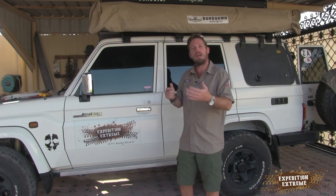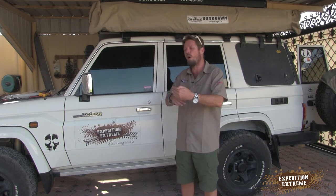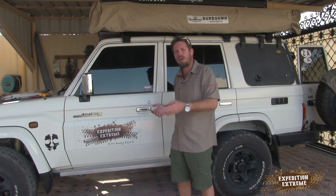However, if I'm drawing power and not replacing it sufficiently with my solar panels, I'm going to have the issue that I have right now, where after day 3, day 4, my batteries weren't sufficiently charged, so the overnight usage was bringing my batteries down to 8 volts, and it's obviously killed them.